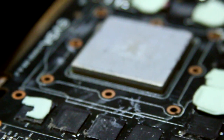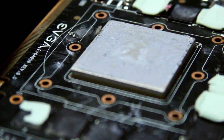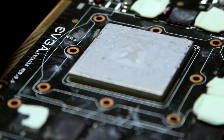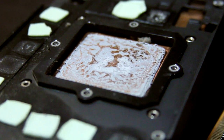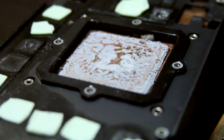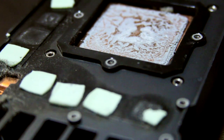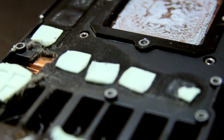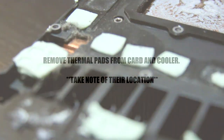Just as I suspected, this graphics card is suffering from dried cracked thermal paste. The thermal paste has hardened over time which has really reduced the amount of heat it's able to transfer, due to the cracked corrosive state of the compound. The culprit in this overheating graphics card is dry compound that is no longer doing its job — not getting the heat to the heat sink and out of the graphics card. Over time this is going to lead to inevitable death of this graphics card.